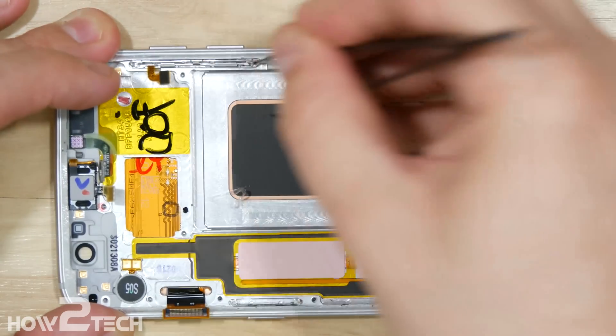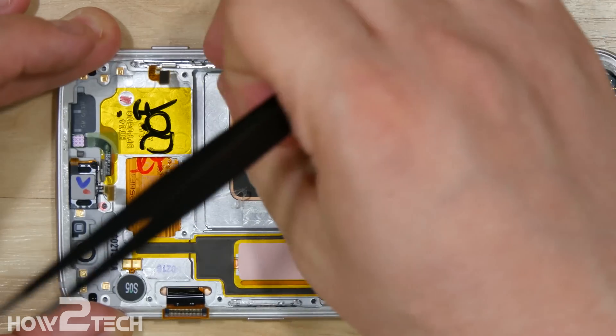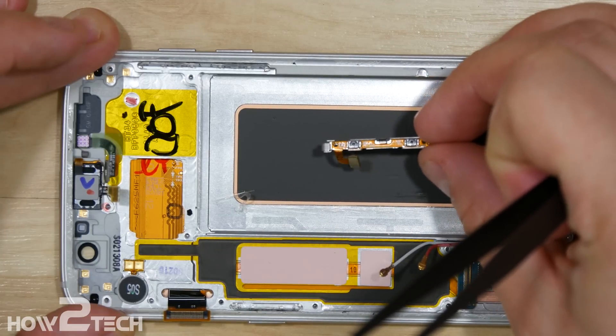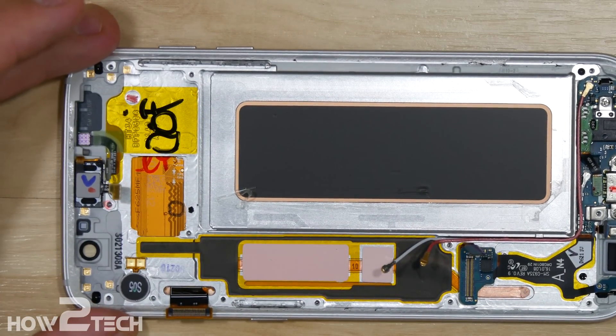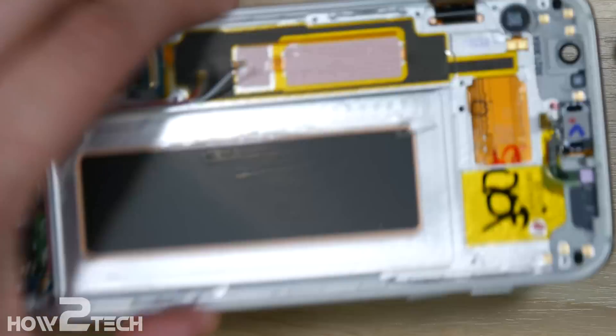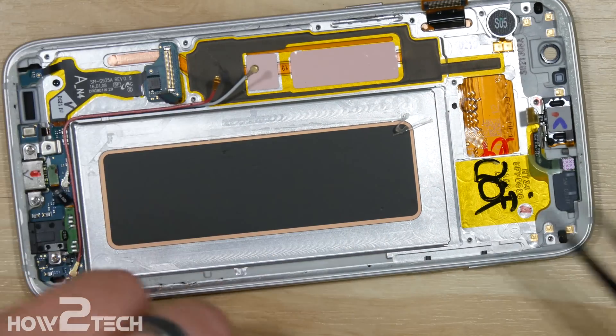The little metal bracket may pop out. You can see on this one — just put it in between the bracket and the actual portion holding the button. This is the volume up and down. You can see it's just a little ribbon cable on top of the bracket — that's how it's held in place. You may have one of these little brackets pop out, and that's completely fine. You can go ahead and put that back in during reassembly.